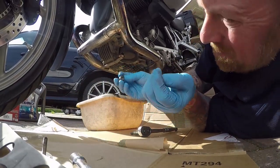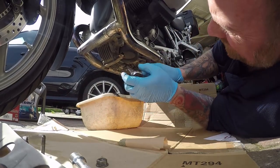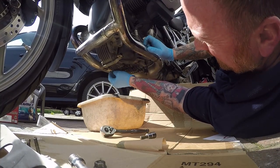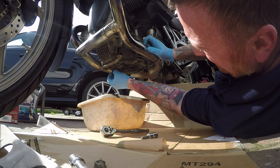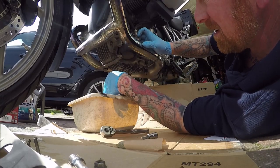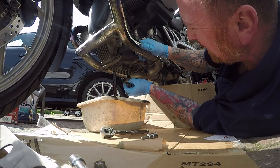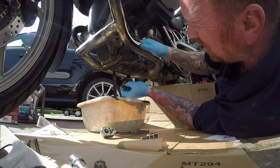Plate off. 13mm, a few cross heads, 8mm for the Allen key socket. Remember the old washing up bowl — let's wait for the oil to come out. This has been in around about 8,000, 7,500 miles. Look at it go! That's not a bad colour. I don't know if any of you watched my Ducati video recently — that was really gunky black oil. But that is good quality oil.